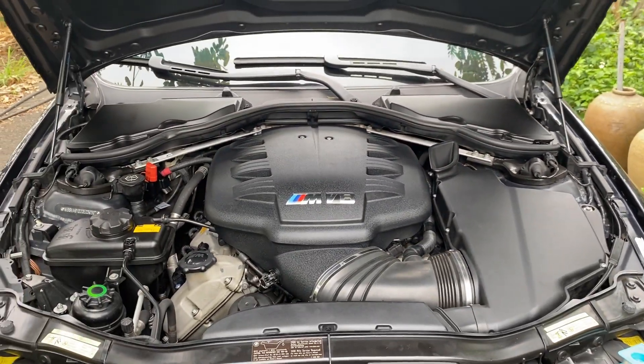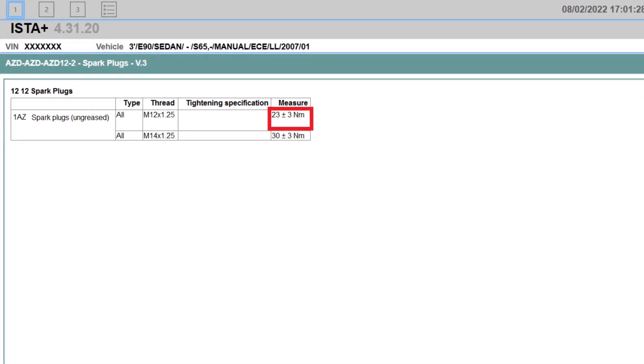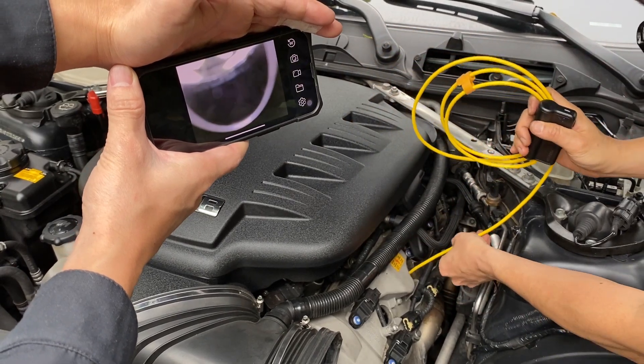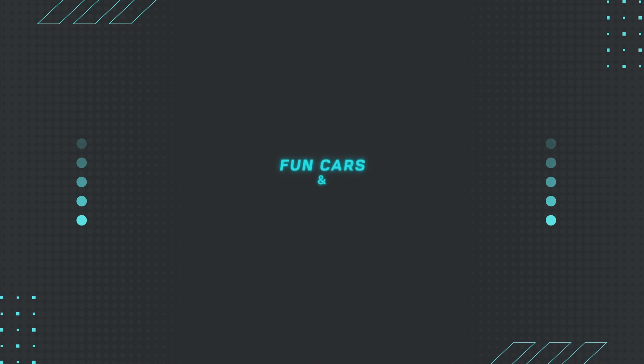That's pretty much all for the spark plug and ignition coil service. Please pay extra attention to the tightening torque of the spark plugs because this engine is made of aluminum alloy. As the spark plugs were removed, I also took a chance to inspect the cylinder walls with the endoscope or borescope. The S65 engine can rev up to 8400 RPM, so it surely needs extra care and love. Be sure to use correct engine oil and always warm up the engine before having fun with it. Here is one example of the 8 cylinders — what do you think about its condition? You are very welcome to leave a comment below, and don't forget to share your useful tips for servicing this magnificent S65 M-Power engine. See you next time. Bye.